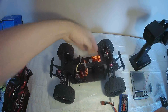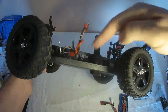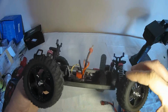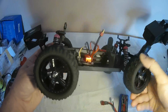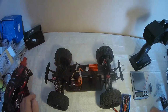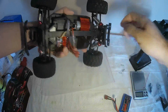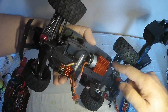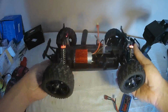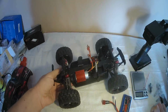Okay, so except that, for the whole element, for example, the main shaft, I hope you will be able to see, the main shaft is in nylon, the transmission shaft is in nylon, not a metallic one, so versus time could be an open question, but it's protected by this top plastic one. The pinion and the main wheel are protected completely, jailed in the plastic cover, and the main open question is whether this cover will be enough to protect from sand intrusion, dust, etc.